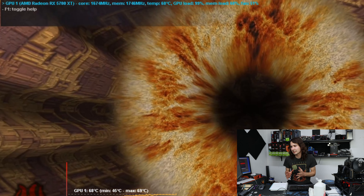It looks like it's peaking out at 68, unless it wants to creep up to 69. It was a very small difference — like one or two degrees. I honestly couldn't see this making that big of a difference. Maybe inside a rig where you have less total airflow, you might get a little bit more out of it, especially where you're working with thinner margins. But it's already up to 69 degrees — it's getting a little hot in here too. Realistically, it looks like we're sitting at 69 degrees, which is only a single Celsius drop. It's hitting 70 now, but it's getting kind of warm in here, so the room temperature might have changed a bit. I don't see it being that big of a gain.